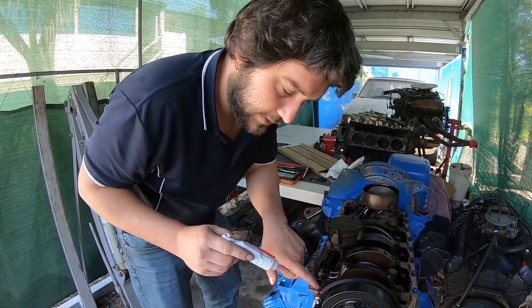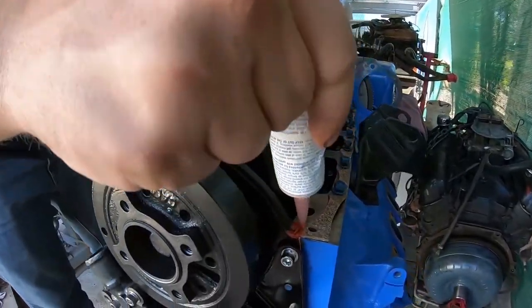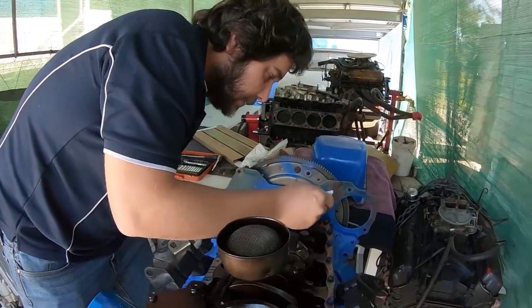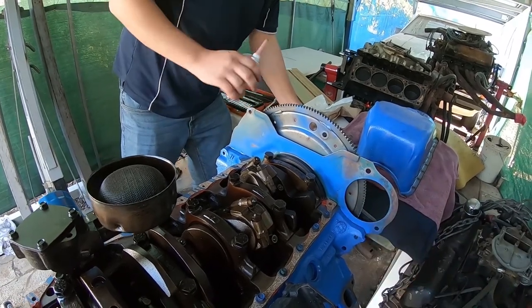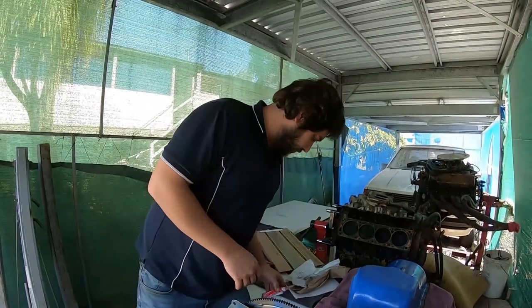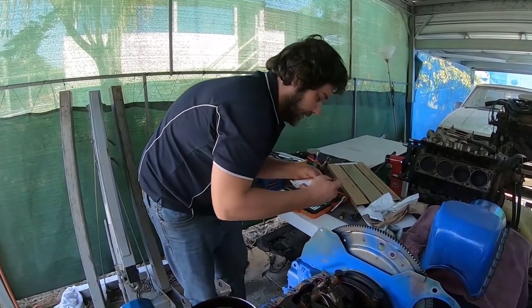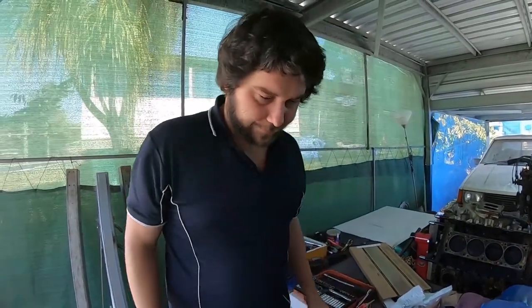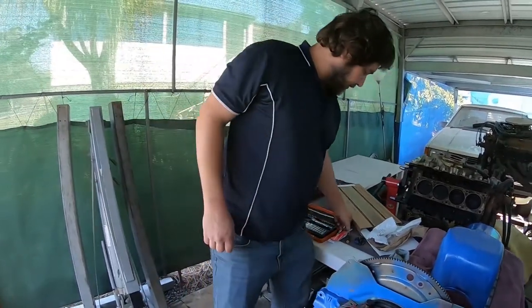There's a slight discrepancy from here to here so I'll put the tiniest little bit there. Anywhere where two gaskets are going to meet at corners, just in case there's a bit of a step or a ledge, get a tiny little bit of silicone on there. Now put this lid back on — this will be good until we come to do the intake later on. I love that tip — it's just annoying having to empty that tube out if it dries in the nib.